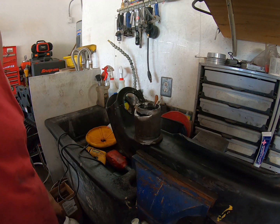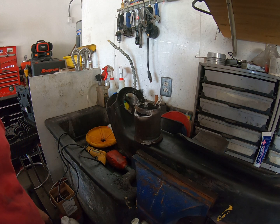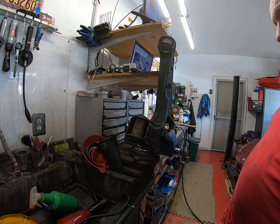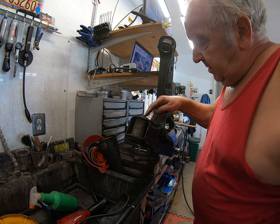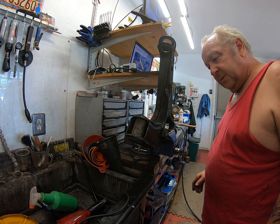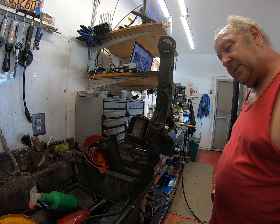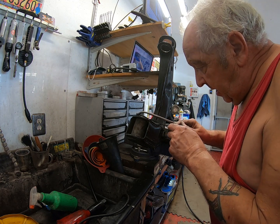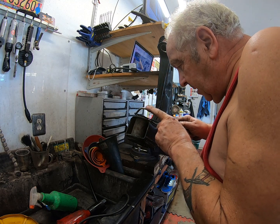So there you go. Now let's move on to the second one, which is even more fun. Right, in order to get this second one out, you always need to push the centerpiece out and get it out of the way, because it's a bloody pain in the ass otherwise. I use my trusty little junior hacksaw and I cut that rubber away.